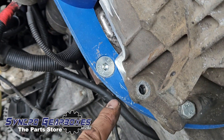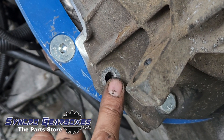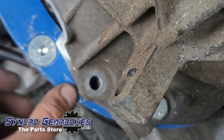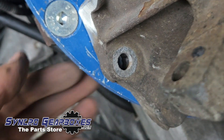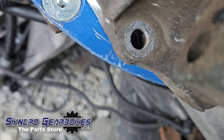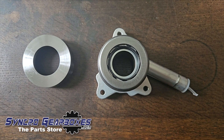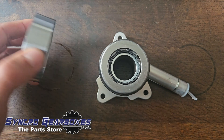On the left-hand side hole of the gearbox, you might find the through hole is blank because the sump is behind the adapter plate with no hole in the sump — just run a drill bit through there with the gearbox off, and you'll be able to put a nut and bolt through. The next bit of gearbox prep is fitting the clutch slave bearing shim, which places over the end of the clutch release bearing.